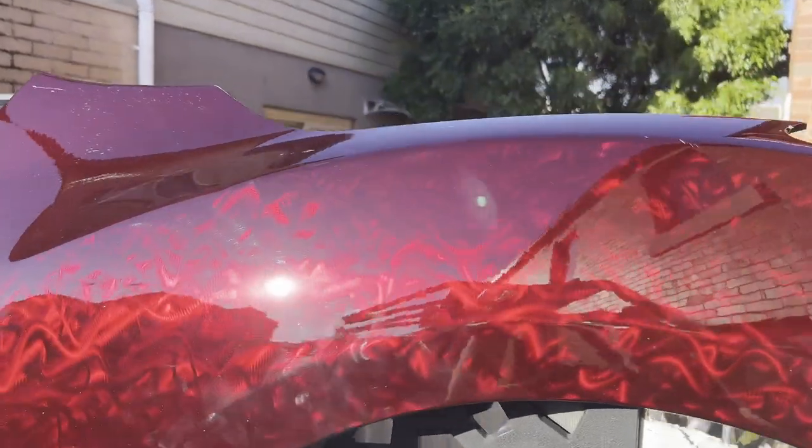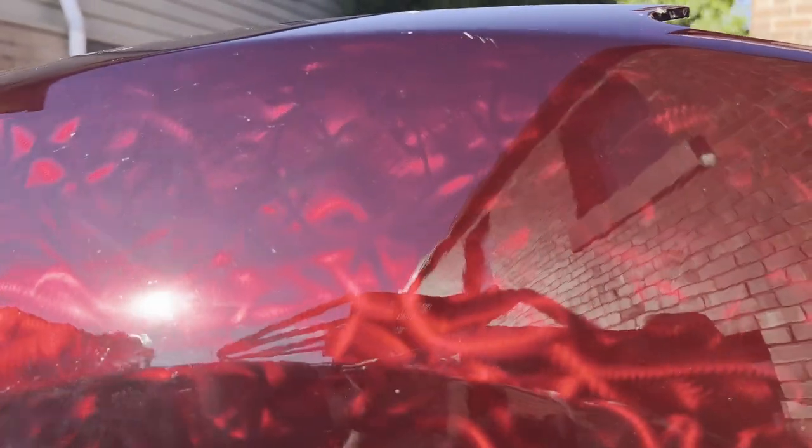So the moral of the video, to be quite frank, is to see what kind of surface rust I got from handling the panel without rubber gloves on and without using that steel conditioner. And 6 months later, I've had a really good look at it. I can't see any signs of surface rust on the panel. No fingerprint outlines. I can't see anything. Now, in saying that, that's probably due to the darkness of the candy, and trying to get the panel in the right light to show any signs of rust is a little bit tricky, I must admit.